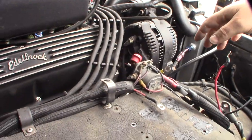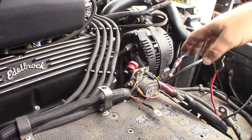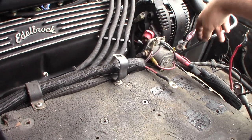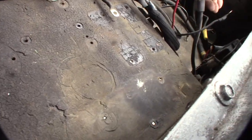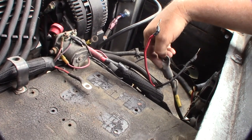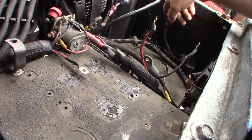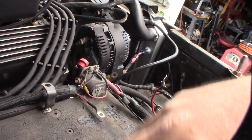I spent a lot of time figuring out audio noise issues. I have a ground strap going right from the engine case to make sure I have a connection between the block and the battery. I also had another strap going from the battery's threaded post straight to the frame of the Bronco. This solved all the humming noises on my amp and radio — just having good grounds.